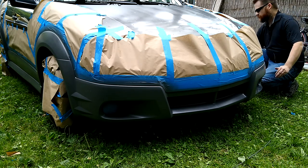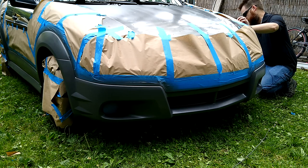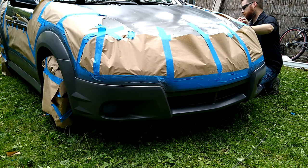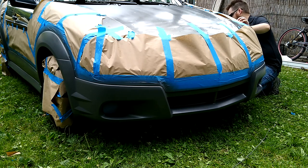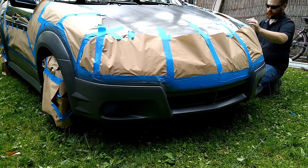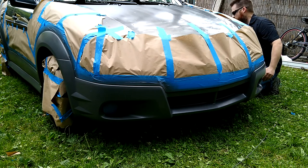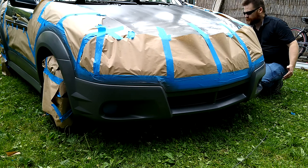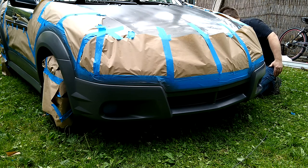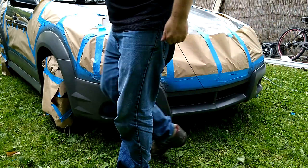Now, while a person might just go out and buy a can of spray paint of any design, this is nice because it's designed for what it's for. What I'm doing is what the paint maker anticipates, so problems can be thought of and avoided just in the formulation. They know I'm going to do multiple successive coats. They know I'm expecting it to cover. Also, flexibility comes into play. A lot of the plastic paints are designed to be a lot more flexible, so that if it's the dead of winter and things start moving around a little bit, it doesn't just come flying off.